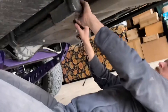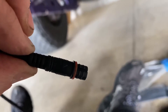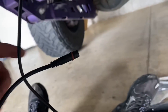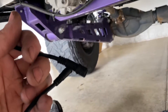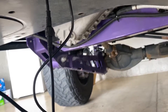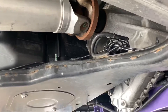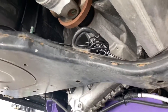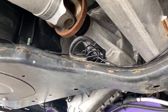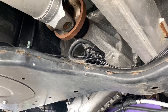Just working on wiring this up, almost done. I wanted to point out that on the connectors coming from the module there's going to be an arrow, and the wire coming from the actual rock lights will have an arrow as well. You line up the arrows and then screw it in tight — that way you're not just jamming it in and ruining the plugs. Got all the rock lights wired up at all four wheels, but I did need those extra 16-gauge wires from Advanced Auto because many of these rock light kits don't come with enough wire to reach the module in the engine bay.